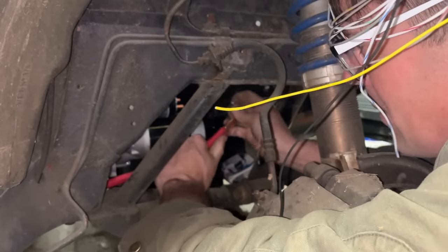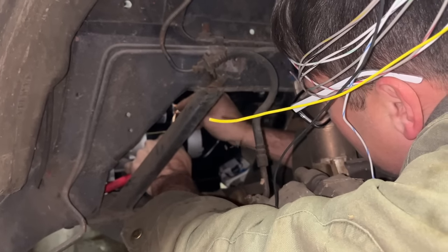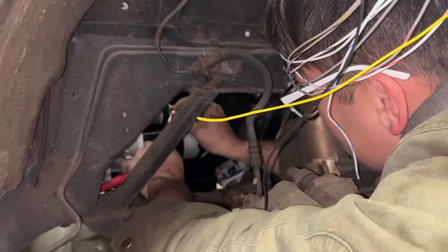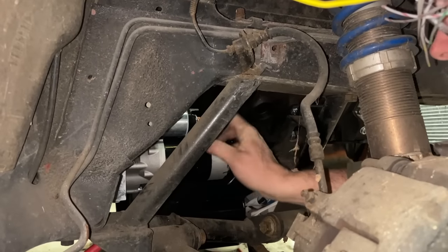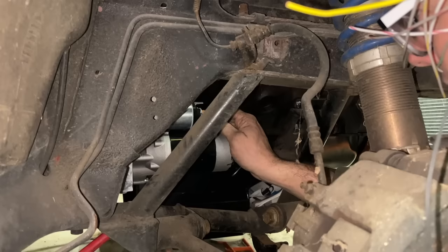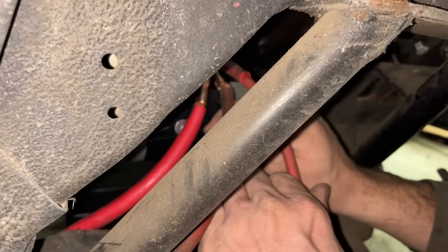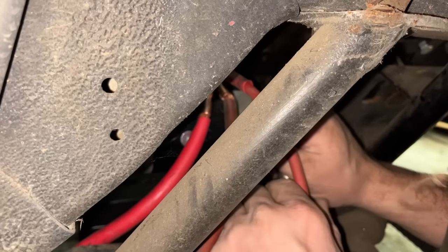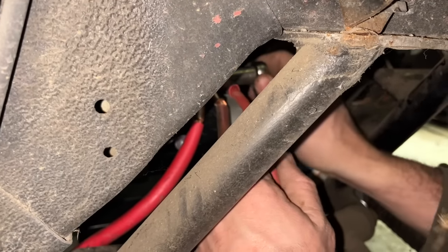So my idea for my power supply is I'm gonna put this main battery cable straight to the starter. I'm also gonna connect our charging wire to this lug and probably another power wire going up to power all that stuff underneath the dash. That way the starter has the best shot at starting this thing. We have a 2 gauge that's gonna go up underneath our dash and power everything. And then I've got a 6 gauge charging wire I'm gonna send over to the alternator.